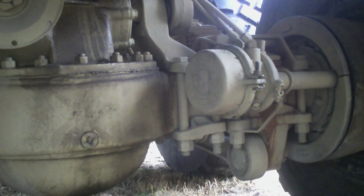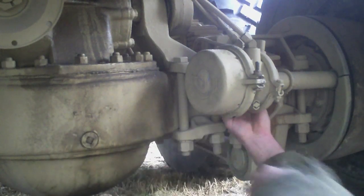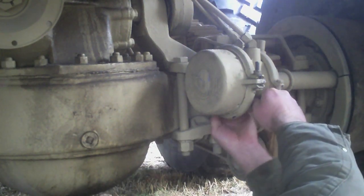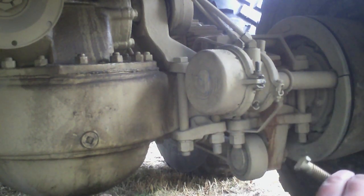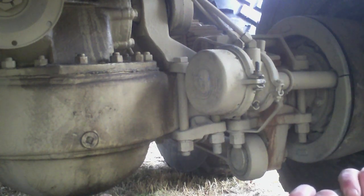The rubber in here is five dollars, so again I'm not saying you should do this — in fact I'm saying you shouldn't — but you can watch me do it. First things first: the truck's been sitting here for quite some time and it has zero air pressure left in it, which is good. But you're going to want to double check that, and you're going to want to make sure it's chocked — or you can do what I do here in the wintertime and let it freeze itself into the divots it creates when you park it. All spring brakes in theory are locked. This is your caging tool right here.